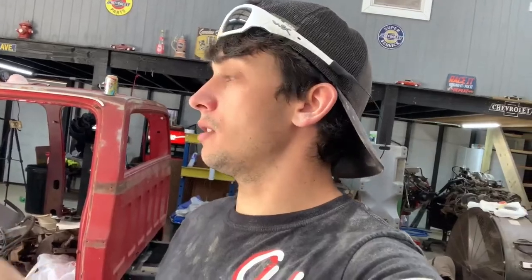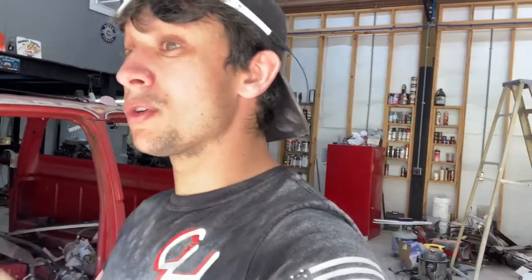Finally got the car blocked. There are one or two little spots on the passenger side that I found when I blocked out the guide coat that are a little bit low, so they're just gonna require skim. It's nothing crazy. Overall, the body was super, super straight on the passenger side, so I'm very, very happy with that.